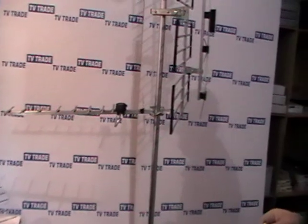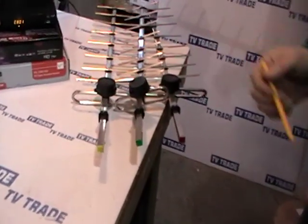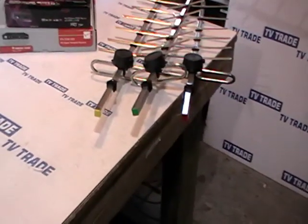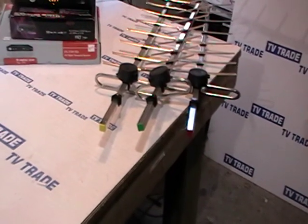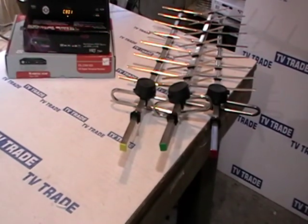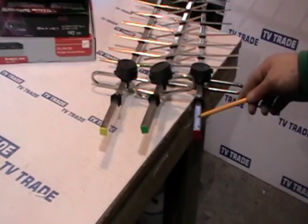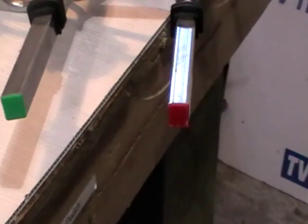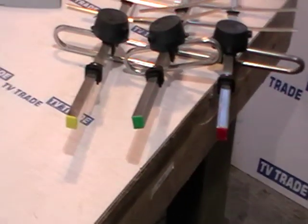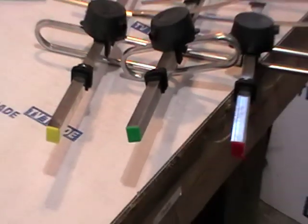The alternative, if you know exactly what type of aerial you need, is to go for a low-cost option that gives high gain by choosing a color-coded aerial. The UHF spectrum is broken into three bands. At the bottom of the UHF spectrum is Group A, with a red-tipped aerial. Moving up is Group B, which is yellow-tipped and covers the mid UHF bands. Then there's a green tip which covers the top end of the UHF spectrum, all the way up to channel 68.